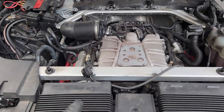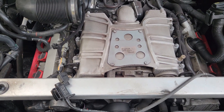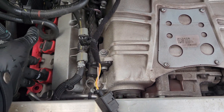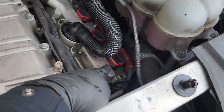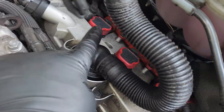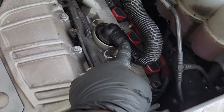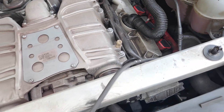So let's go to the firing order. The firing order for this Audi six-cylinder is going to start from right here. It's going to be one, and then goes to four right over there, and then goes to three right over there, and then goes to six, and then comes to two, and then finally it will end with five.